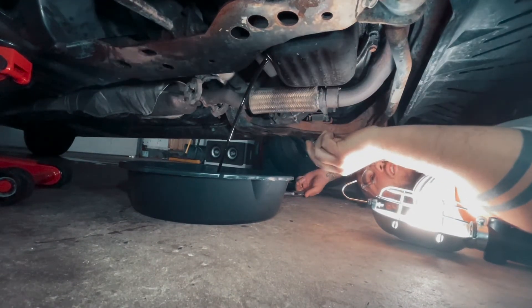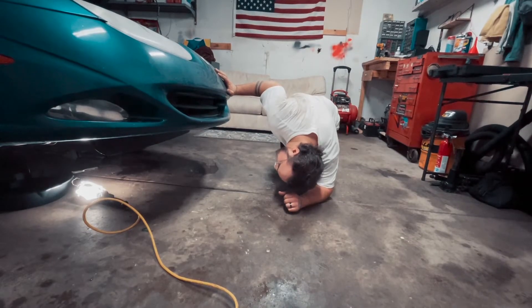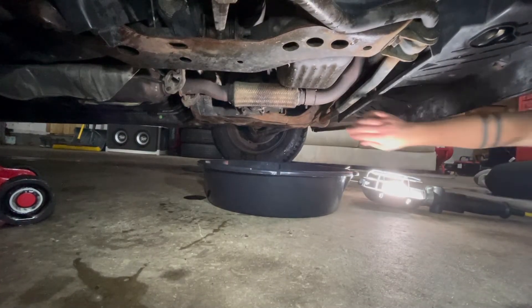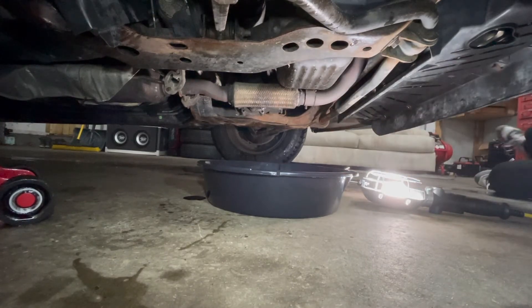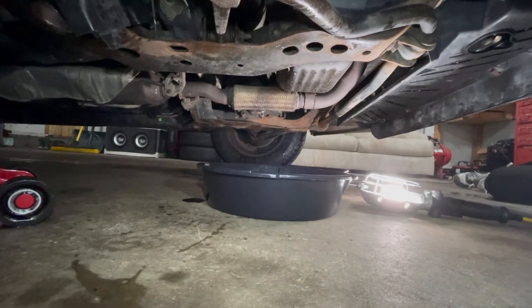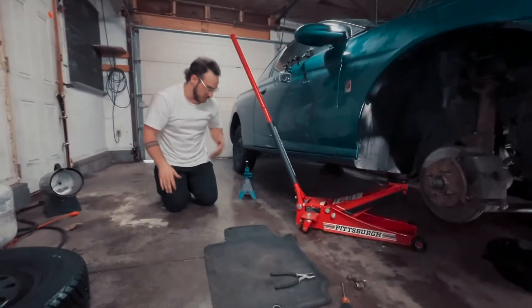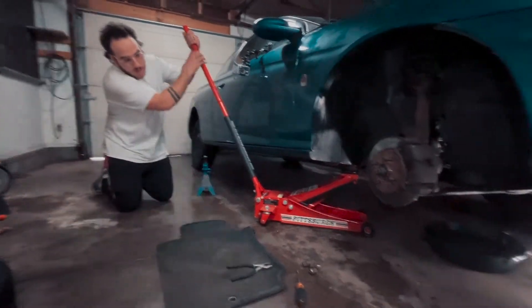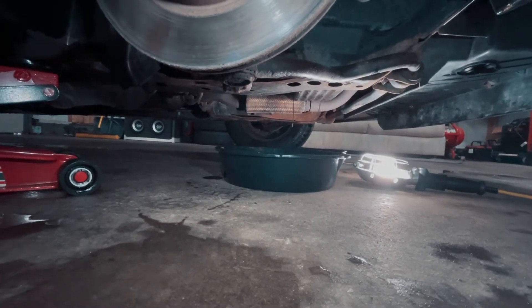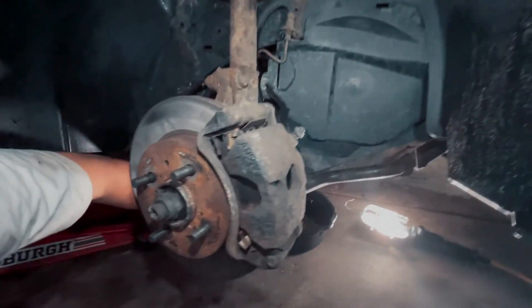The issue with the location of the oil pan drain is that it's on this side, so you're going to still have a bunch of oil on the other side. The way you can fix that is either jack up the other side a little bit to level it out, or drop your jack stand down just a little bit. You do want to do this very slowly because you don't want to drop it down on the rotor. Pull your oil pan out as far as you can — it's still under there. That looks good.